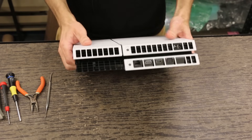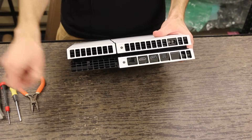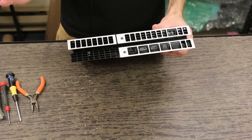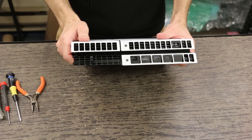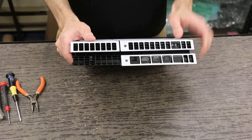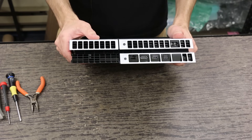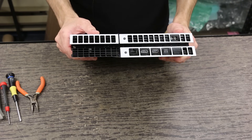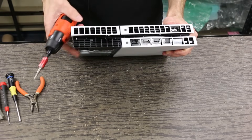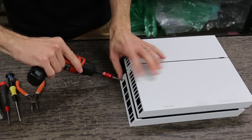The next thing we're going to do is take these two screws off. Normally there's warranty stickers here that you take off using this pick — you can just get it in there and pull it right off. I have already removed those since I've done several teardowns of this already. What is also different is there's not a screw there and not a screw there like on the previous models, so that makes it a little bit quicker to get into. I'm going to be using electric screwdrivers again on this just to make sure we can get this done quickly.